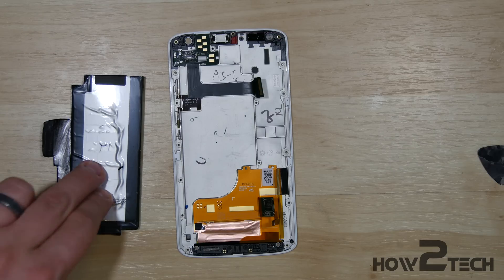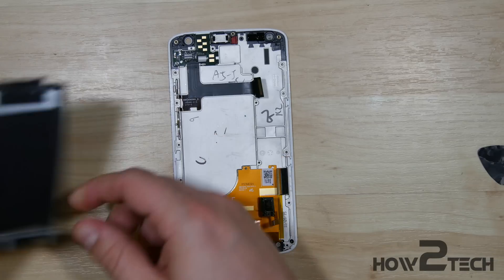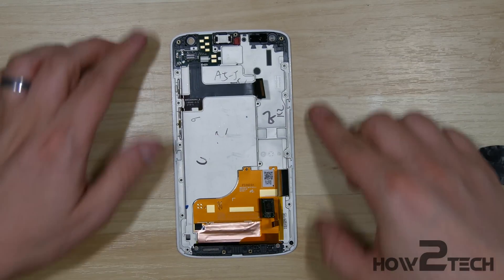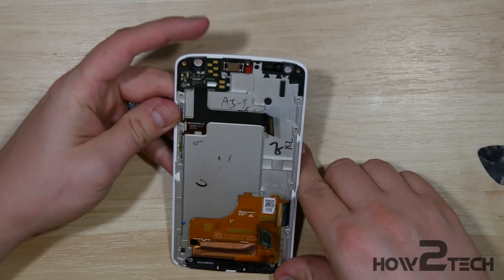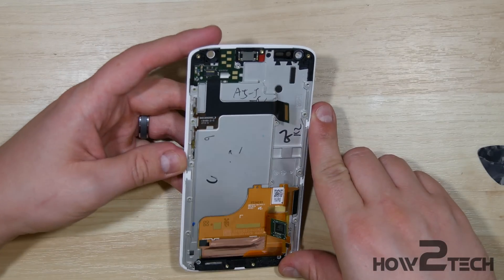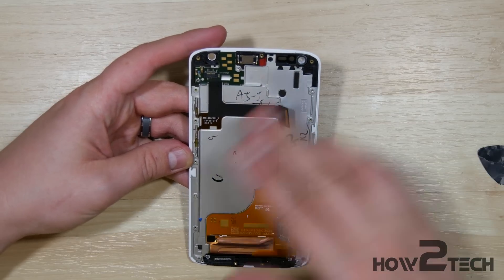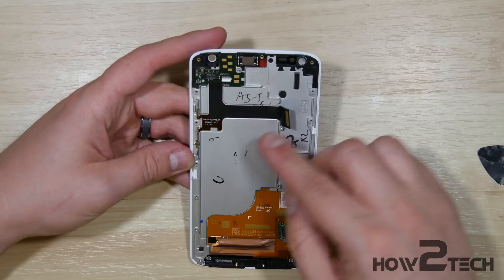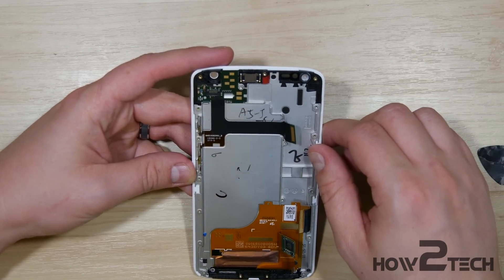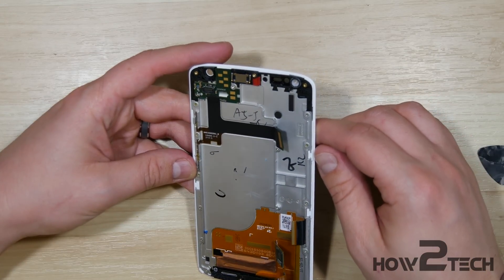So really that's the majority of the disassembly of this phone. There are a couple more things you could do — you could replace the volume button and power button, though it's a shame they put them so deep into the phone that you have to take the whole thing apart to get to them. There's an antenna board up here with some connectors that should be removed as well — just pull the cable back and get that removed. Hopefully the display you buy comes with everything; if not, you'd have to transfer it over. Anyway, I appreciate you watching the video. If you want to see the reassembly, I'll throw that down in the description below, along with some links for tools and replacement parts. As always, I appreciate you watching — hope to catch you in the next one. Peace.